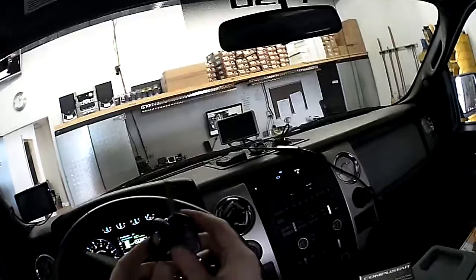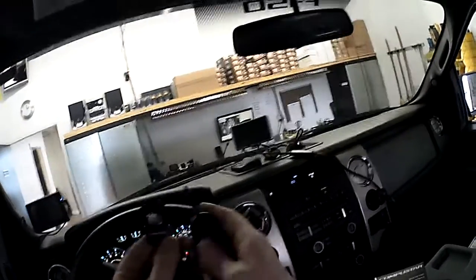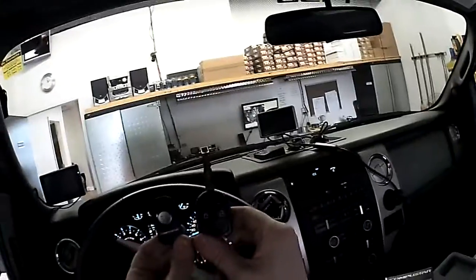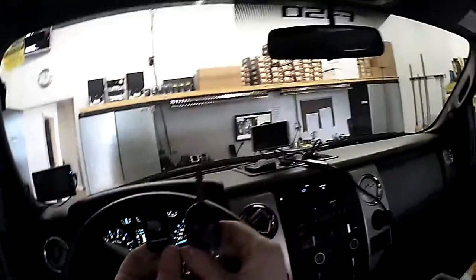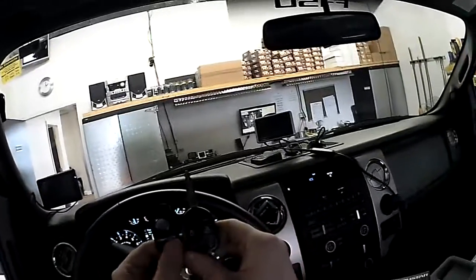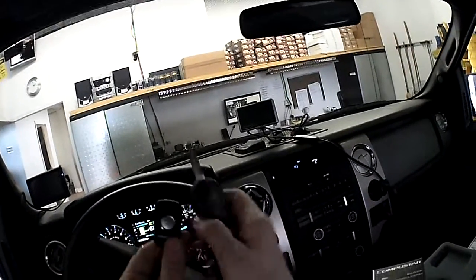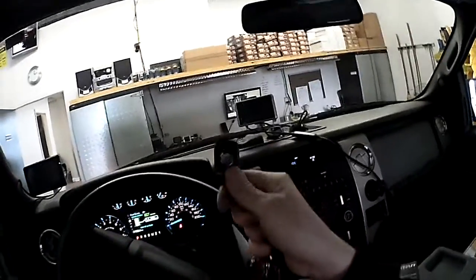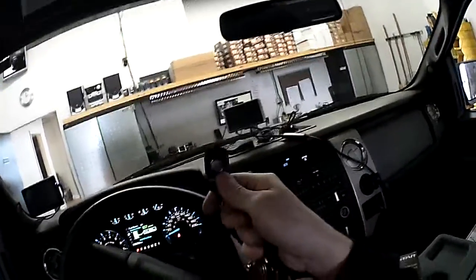The other reason the lock integration comes in handy is because some vehicles require you to control the factory alarm — this is one of them — so that it disarms upon remote start and rearms after start. On this vehicle, the factory alarm system is tied in through the door locking circuit, so I integrated it for that reason.